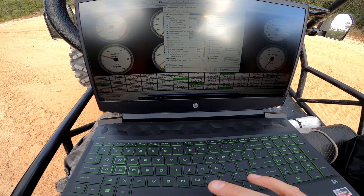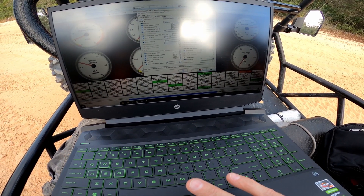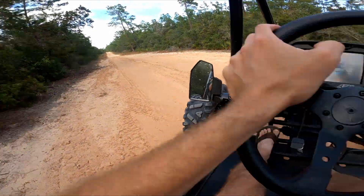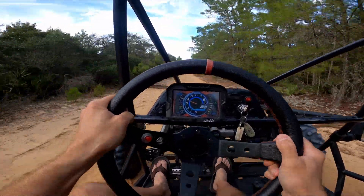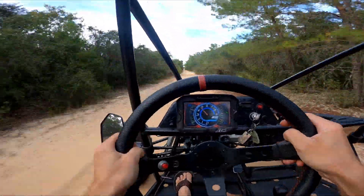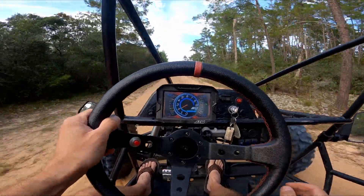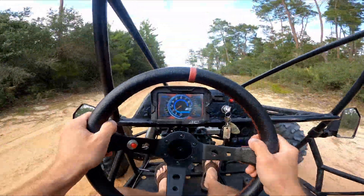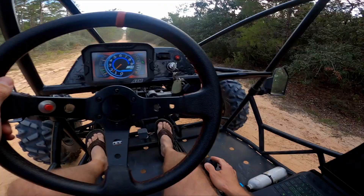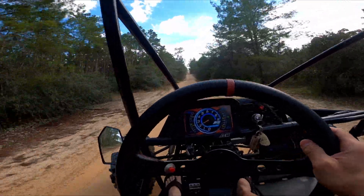I don't think my ignition needs to retard much unless I want it to pop and bang. 5,500 RPM with 10 degrees — that should give us a nice little snap, crack, one pop. I could feel the boost pressure was definitely higher on that shift, on that gear change. So I think the little bit of retarded ignition, it's almost like an anti-lag. Now keep in mind, this is not an anti-lag setup. But dang, she is a bad girl. There was definitely more boost going into that shift than there was the last time.